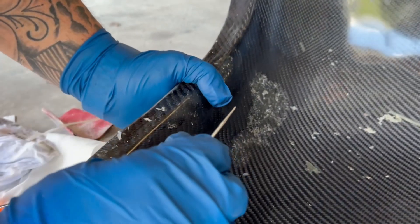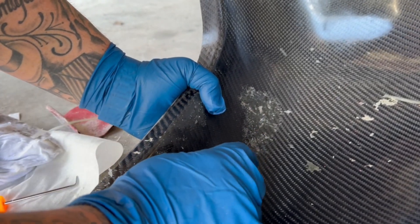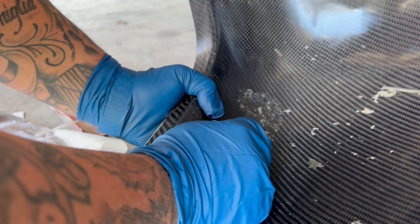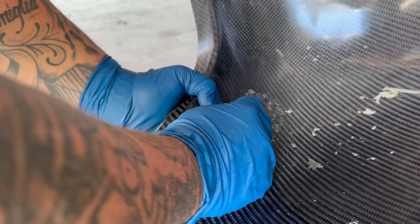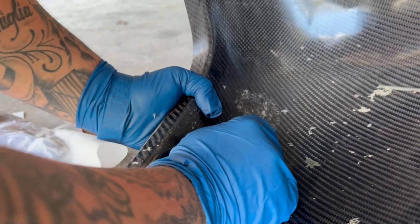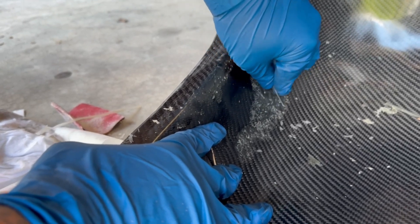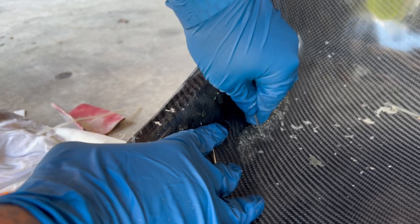So real quick, just to show you guys — after further inspection, this here is actually just a terrible repair already attempted. No offense to whoever did this before me, but when I started picking these little spots we have a lot of delamination in this top layer of resin. I'm glad I didn't just sand it and think it was good. That's why this picking stage is definitely important — to get all of this old unstuck resin off. You don't want to put resin on top of it because then it's still not sticking to the part, it's just sticking to the loose resin.